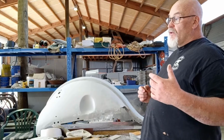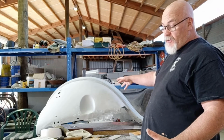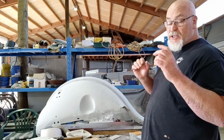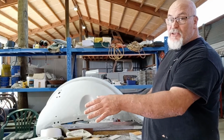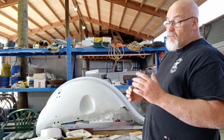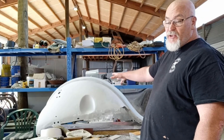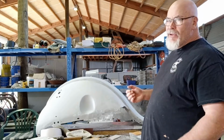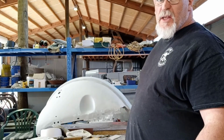So next time, if I ever have to do something with things like this again that I've got to put this much work into, it would be different if they're in really good shape and you just had a couple of little imperfections to get out. Basically, you just prime them, maybe a little bit of skim of filler or putty in that damaged area, and all you have to do is prime them and block them back, and prime them and block them back until you get any little imperfections out. That's easy. It's when you've been dealing with something that's been beaten to snot. You've got it into pretty close shape with that metal finishing, and then you've tried to get the rest of it in, if you know what I mean. And it's just been a pig of a job.